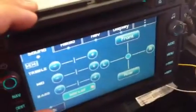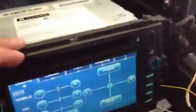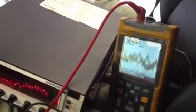Cool stuff. Stock GM nav deck into Bose — we're just tapped into the front speaker output. So we know we have 20 to 20k. I've already scoped the output, and at full tilt I have 2.2 volts, clean on 40 hertz and 1 kilohertz. So we're good to go.